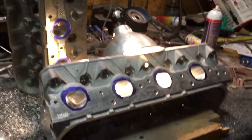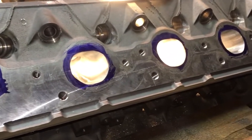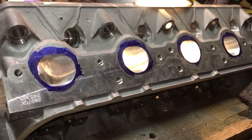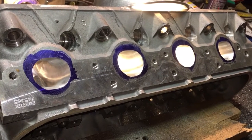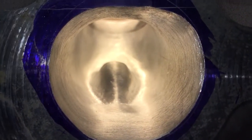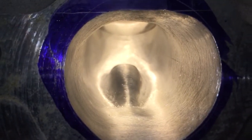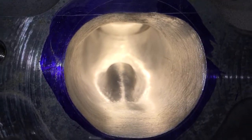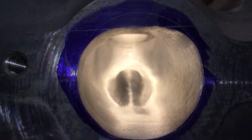When I look at this, you can see how shiny a 120 grit finish is. If you look at the outside of the ports — keep in mind I haven't done the bowl area yet — but look at that, especially this port here. That starts looking like all those really cool ports you see on the internet. But this is an exhaust port. An exhaust port should be super fine finished — rock it out, get it as smooth as you want, mirror polish it, you're good to go.